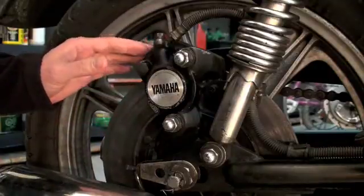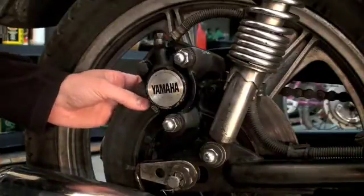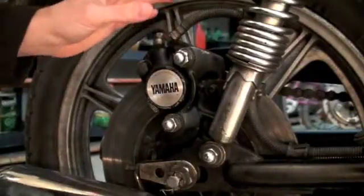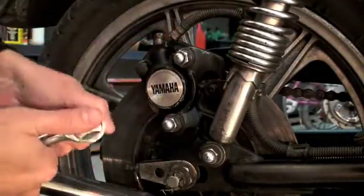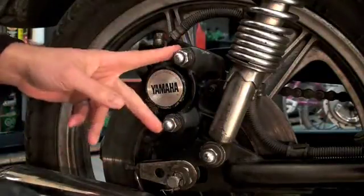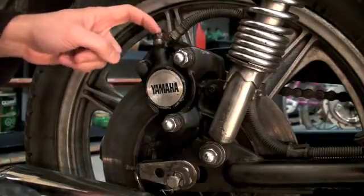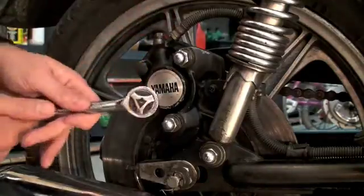That's the kind of problem I was having with this bike — a little bit of drag on the disc. So I had to dismantle the caliper in order to solve the problem. The RD400 rear caliper is held on by two 17 millimeter bolts, these two right here. In order to release the caliper, I'm going to release these bolts. I'm not going to disconnect the brake line because I may not need to do that — disconnecting the brake line causes a lot of other issues. So we just take the caliper off first.